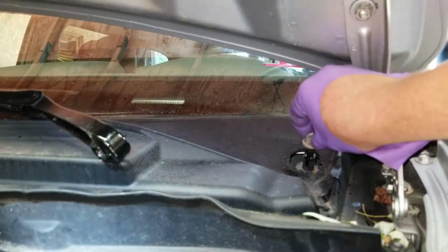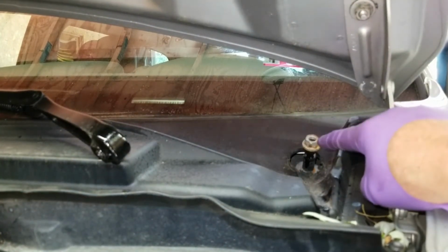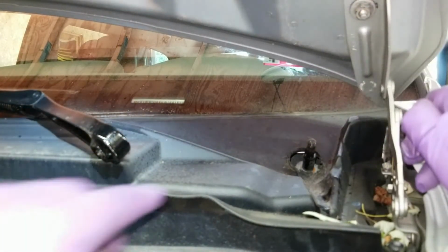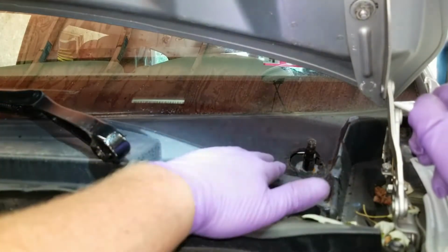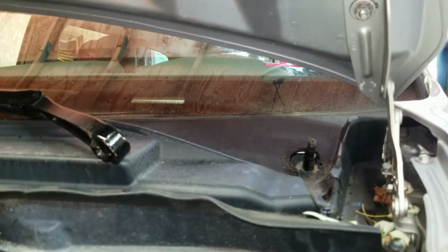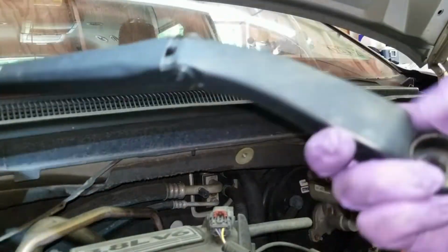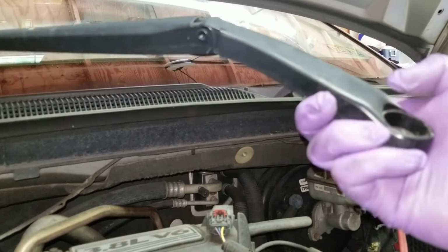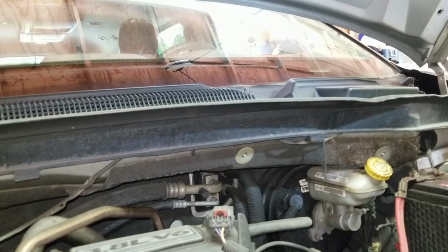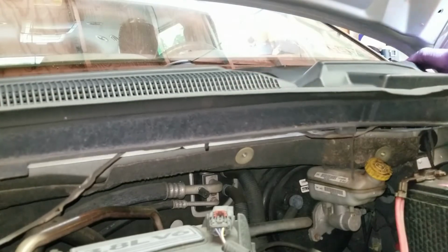Just a flat thing on the impact. I didn't hit it hard enough that it would damage it. You see the nut goes right back on, no problem. No damage. I was prying on the back of it. I don't have a puller for this, so I did the best I could with what I have. Okay, my dad suggested to put the nut back on and tap the nut with the air hammer, and that worked real well. Popped right off. So now we could pull this whole windshield valance.